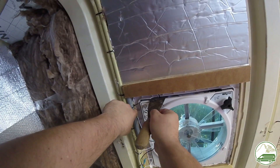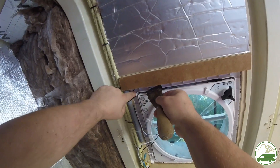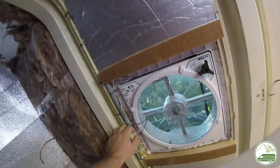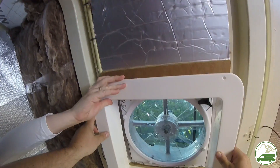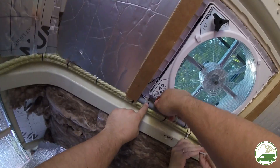Getting the wires out of the way is essential to fit in the interior garnish ring on the inside of the van. We did lots of test fittings to ensure the wires were not in the way. We didn't want to cut the black and white factory wires of the fan to size, so we installed a small grey leftover tube to store the excess wire in.